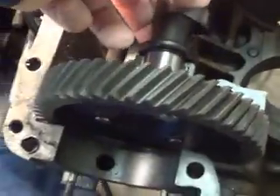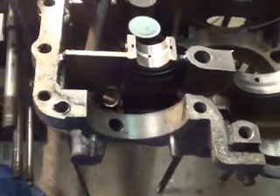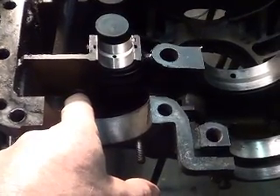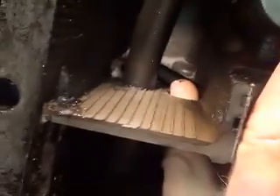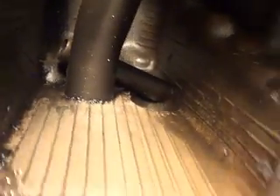As I looked at this, we'll take the cam gear out so we can get a little better view down there, and you can see right there is the hole that Darren's talking about. It looks to me like they ran a boring tool right above the oil hole, straight down at an angle, and they probably had to do another hole to put the oil pickup tube through, and there it is. I'm going to stick my finger down here — there's my finger sticking through there, right above the pickup — and you can see it almost touches the oil dipstick tube spot.